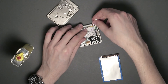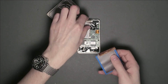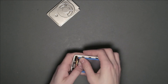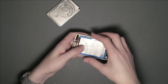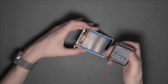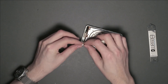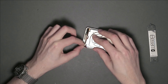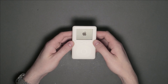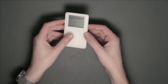To reassemble, the battery goes back in. Then the ribbon cable is connected to the motherboard by pushing it down like so. Lastly, the hard drive goes back in and the battery is reconnected. Now that the iPod has a battery that can power it for longer than a couple of nanoseconds, I can actually test the iPod properly and see if it produces sound.